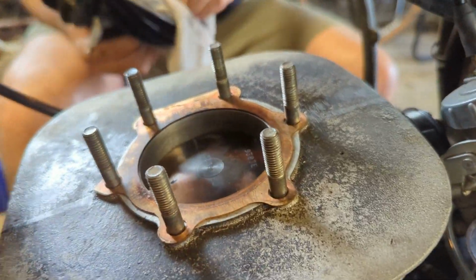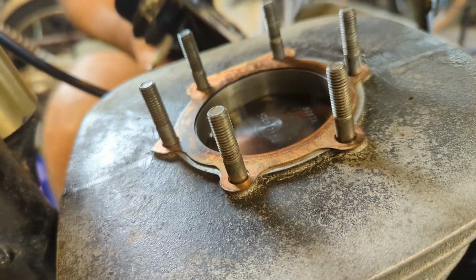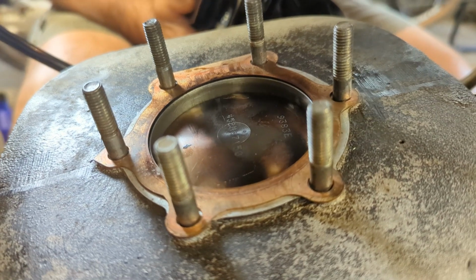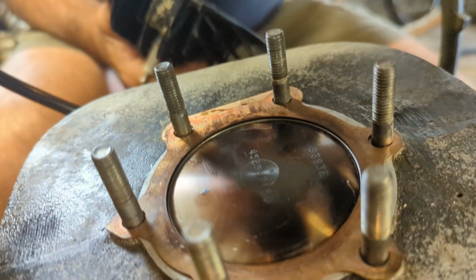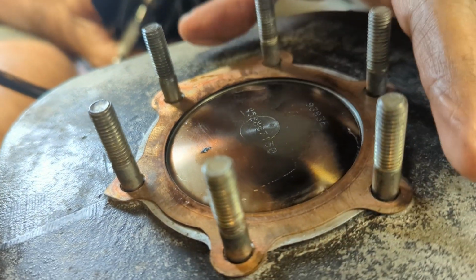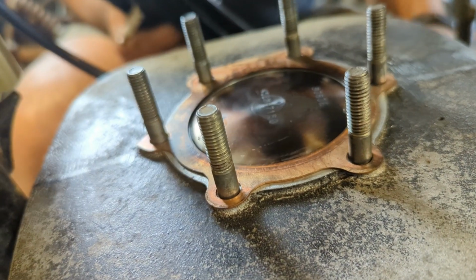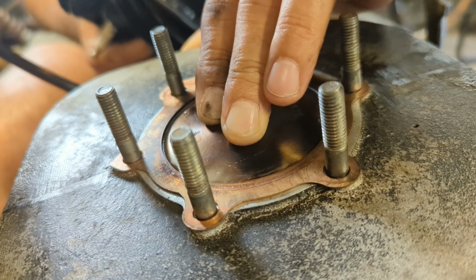Dad, you were cycling it through. What were you looking for there? You're just cycling the engine up and down. Just seeing how the piston feels with the kickstarter pushing through and watching it. Can you show it at TDC? Right there, boy. You can just feel it about to break over. It looked like it was a little low in the jug, but I guess it had a little more room to go on the dials before we pulled it down. But it feels good and tight. No play in it.